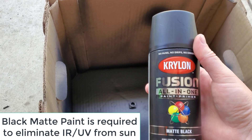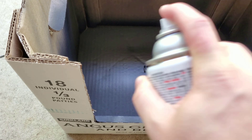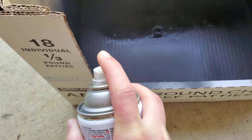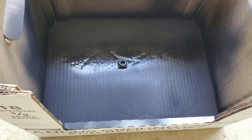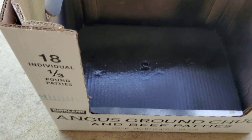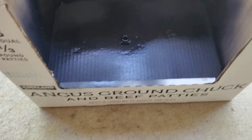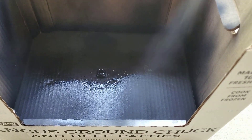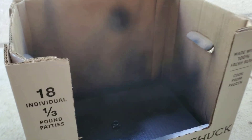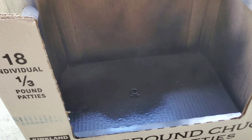Take your Krylon Fusion Paint Matte Black — it's linked in the description, and it's important that it's matte black. Shake it up and spray away. Do a couple of coats, trying to get each side with a little bit of distance. This is typical spray painting: you don't want to go on too heavy, it's better to do lighter coats. If you have the time, do more than one application. Get both the top and the bottom done on separate applications. Really make sure you get the inside of it painted, then let that dry.